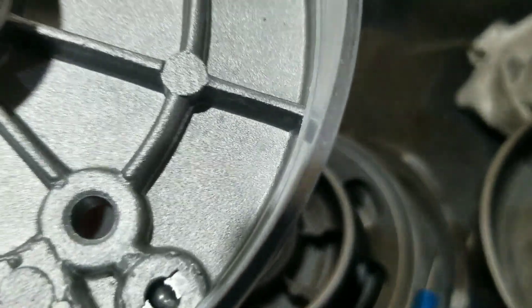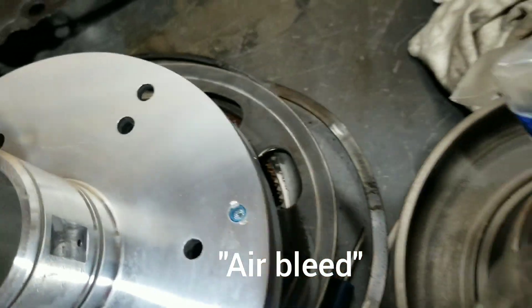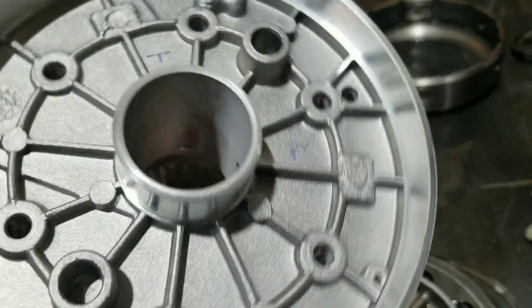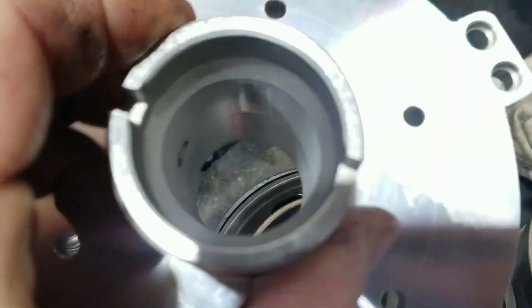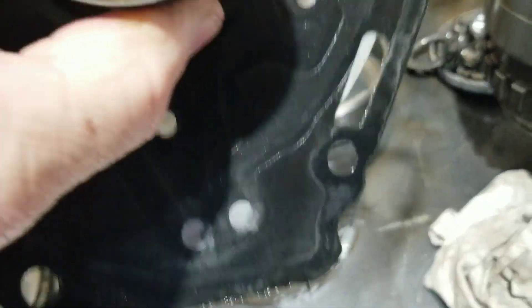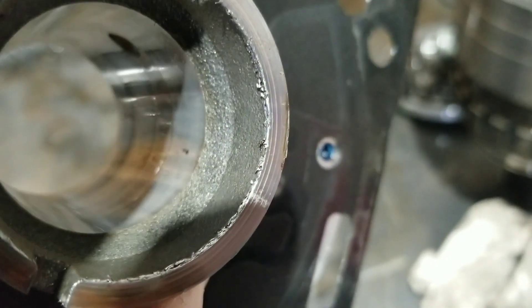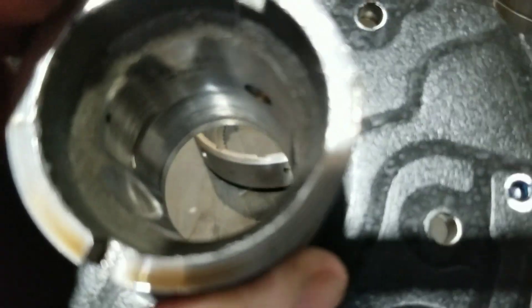There's also a new little check valve, a small orifice - already installed, you don't have to worry about it. You also have double oiling on the shaft inside this thing too - there's one hole there and another one there. The factory only has one. There is not one on the other side. That's probably why that one scored up pretty good - it was lacking lubrication.